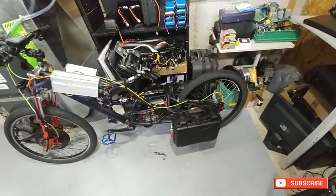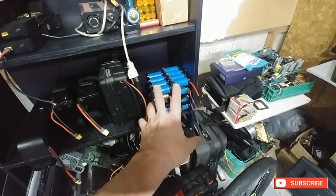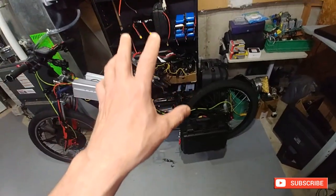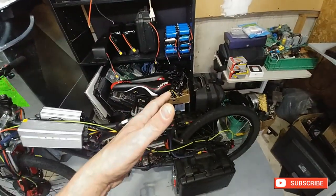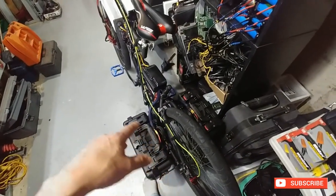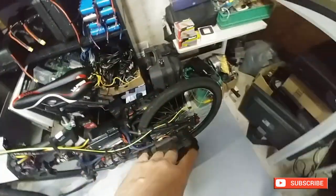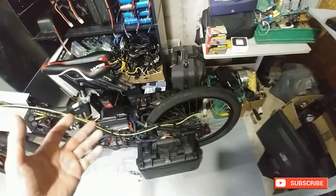I'll probably end up doing this brake upgrade once I get the hub motor and the batteries in. What I've decided on is doing half at 24 volts with a BMS, and then another one with a 24-volt BMS. The problem is there's going to be interaction between the two BMSs, which is an issue. In the past what we did for that is put a rectifier in between each block so they couldn't communicate with each other or feed back into the other one. It seemed to work for a while but then people stopped doing it and it was never heard about again.